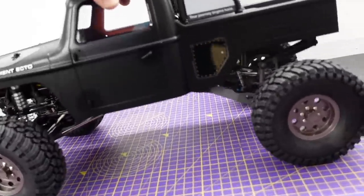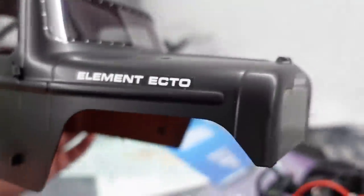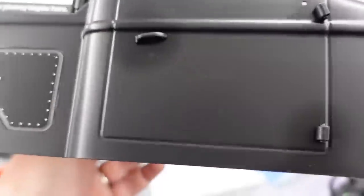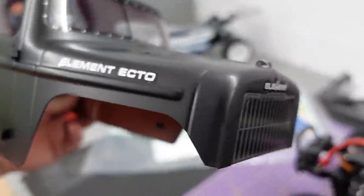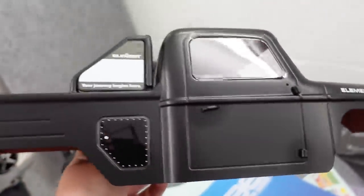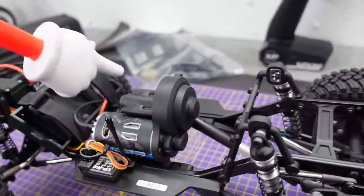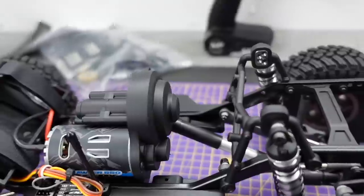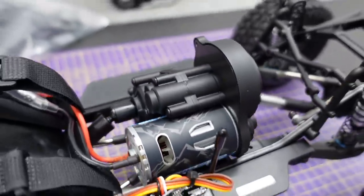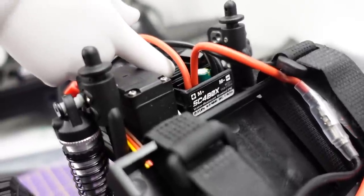They always feel nice out of the box. It's obviously sprayed with an oxide red colour underneath and then satin black sprayed over the top, so when you catch it on rocks and sharp stuff it'll take little bits of that paint off, showing through that red oxide colour and giving it a nice weathered look — hopefully, or it might just look a mess. Underneath we've got the infamous StealthX gearbox — a very good transmission. Lots of people use it in their comp rigs. It runs really quiet and smooth, and it's got adjustable overdrive. You've got a five-slot 550 Reedy motor.